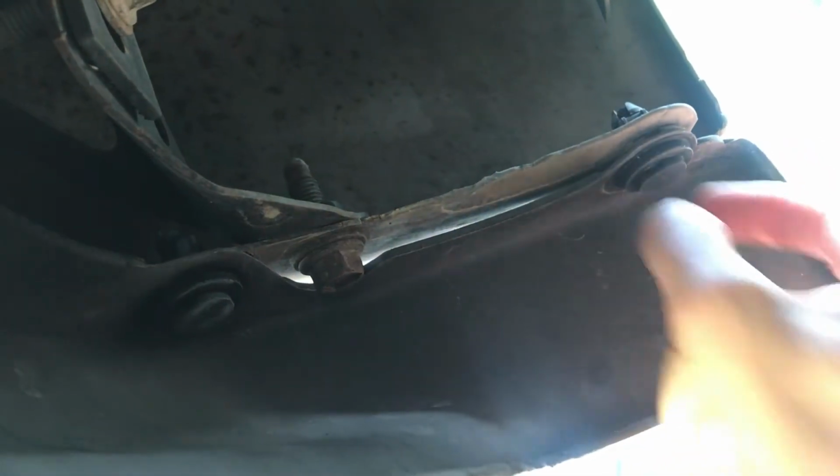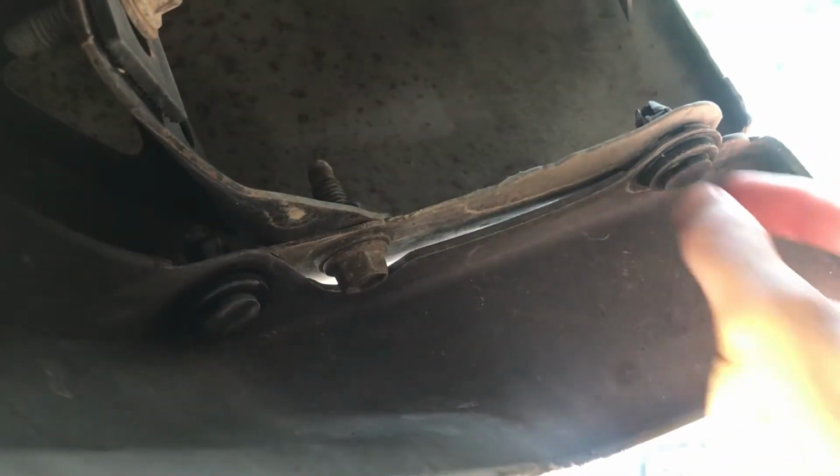Just pop this, it's got these little clips. Just pull the center part out, and then the whole clip will pull out. And that's how this thing attaches all the way around. So I'm gonna go take a screwdriver and pop these out. There's a little notch right there where you can get a screwdriver in there. I think they make an actual tool that catches both sides, but I don't have it. So I use a screwdriver, works well. So I'm gonna get these off, and then we can start mounting the hitch itself.